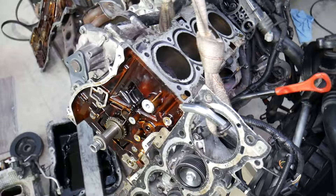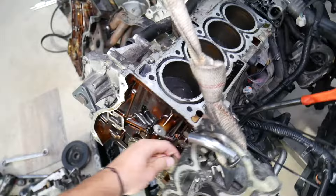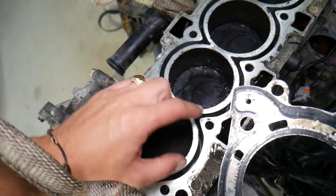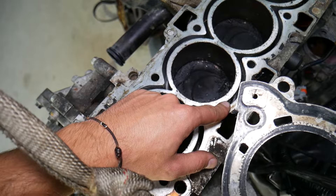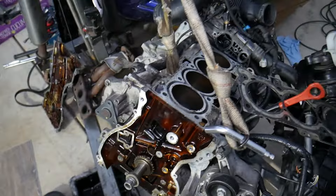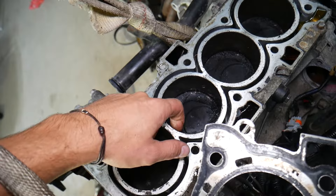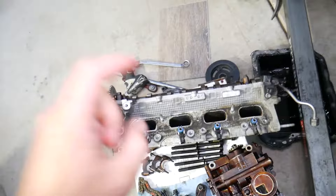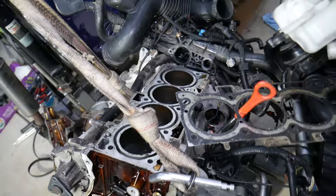Another thing that can cause that — if you overheated the car — could be a blown head gasket. The head gasket has three specific purposes: one is to keep compression in the cylinder; two, to make sure coolant only goes where it's supposed to; and three, to make sure coolant and oil don't mix and coolant doesn't enter the combustion chamber or the oil compartment. When gaskets fail because the car was overheated, it will start pumping hot air into the cooling system, overheating the car and causing coolant to overflow. The same can happen with a cracked cylinder head or cracked engine block.